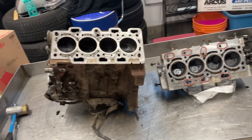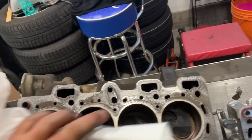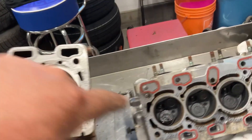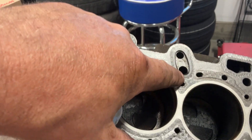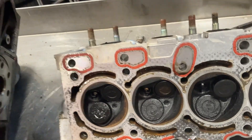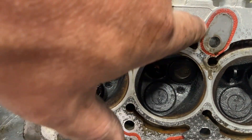I figured it's a good time to stop the time-lapse here — it doesn't take very much at all to tear these down. I've just got the head off, and if you've never opened up the head on one of these engines, they're very interesting how they seal. The oil comes out of the oil pump up through this hole, and where it hits the head is actually a hard stop — there's not a through hole there. The oil actually travels across to this void space through the thickness of the head gasket and goes up this hole right here. That hole — I'll put the head bolt in here — there's a little bit of clearance between the head bolt and the head, and that's actually where the oil travels up through. It's a very strange design, and as you can tell right here, it's very close clearance between the water jacket and the oil passage. This is the o-ring here in the head that seals around the oil passage.